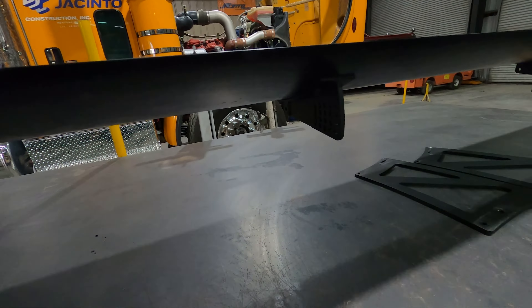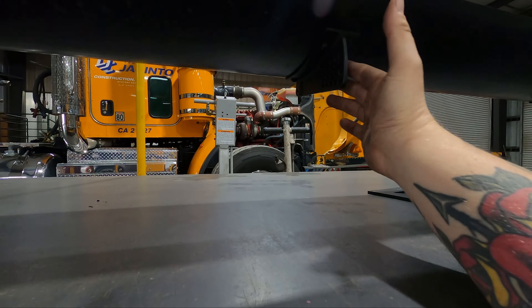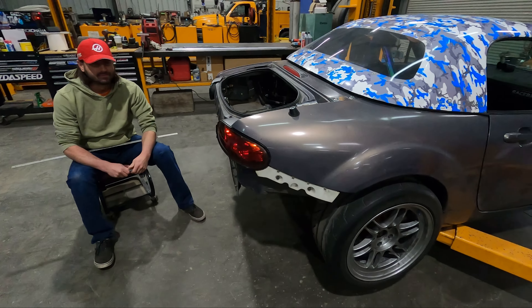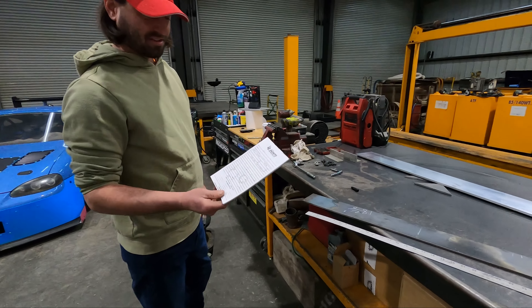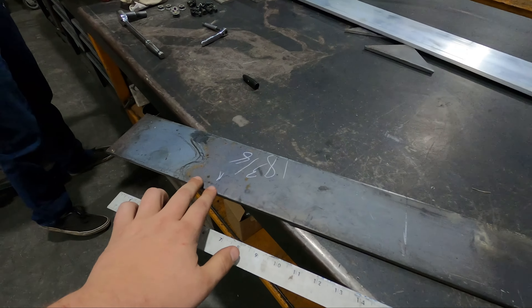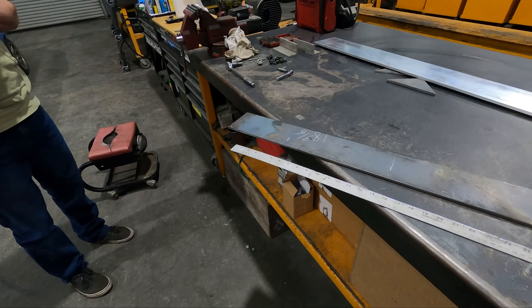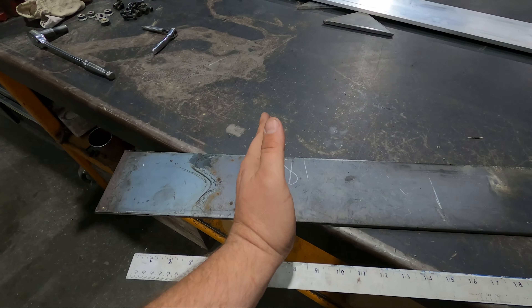What really makes me happy about doing this is, if all goes to plan - and according to Sean it will - I'm not going to have to re-riv-nut these or add any new bracket to the foil itself. I was thinking we might have to riv-nut out to here, but it'd be really cool if I can just keep these mounts, not mess with them, just drill new holes into the new uprights, and all my adjustment is right there. We have some stock material here - Sean's going to measure it. It's going to be four inches tall and about five and a half inches wide.